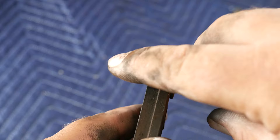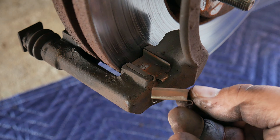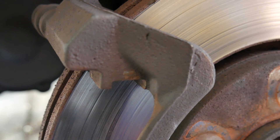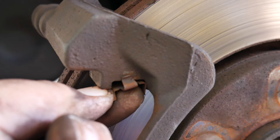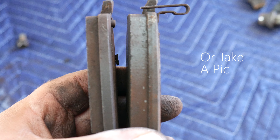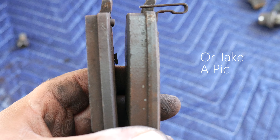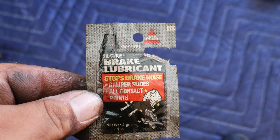One of the clips came off with the brake pad — just look at the other one to see how they're placed and put them back. If you notice your brake hardware is bad, this would be the time to change it. You may have two types of brake pads: one with a little tab on it — that's the one that squeals when the brakes are worn, because that tab rubs against the metal. Usually the one with the tab goes on the outside.